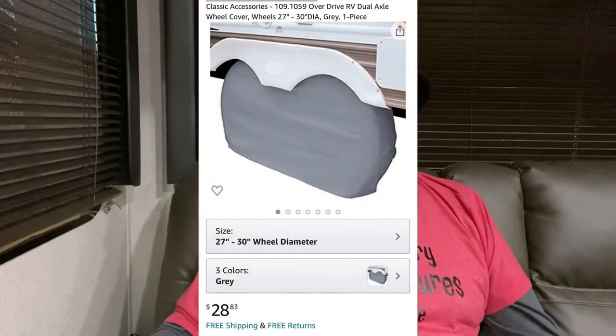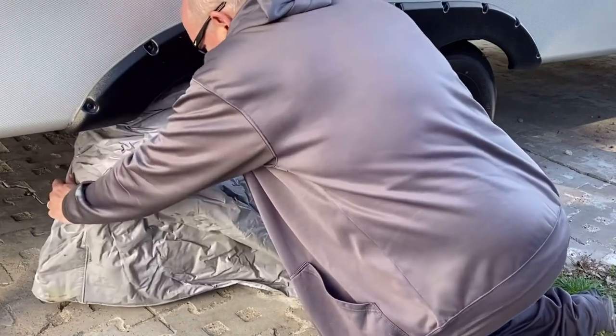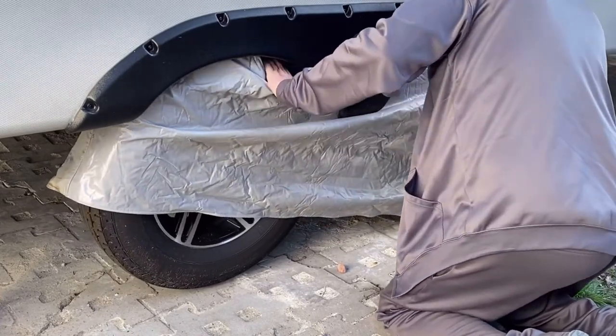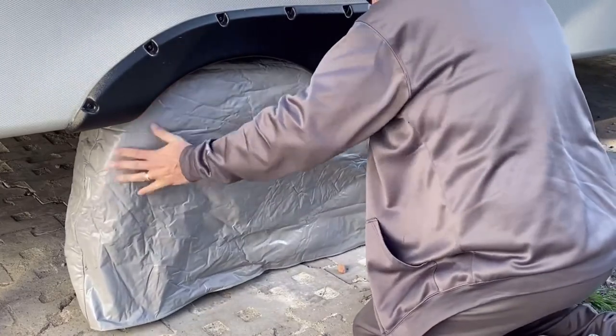The last thing I want to talk about for tire maintenance is winter storage — times when you may not use your camper for extended periods. One thing that is not a tire's friend, besides the speed you drive, is the sun. If you can purchase tire covers — and they don't cost very much at all — they come in single units or ones that cover each tire individually, or the ones I have that fit over a two-tire tandem axle situation. Any time my trailer is going to be sitting for more than a month, I cover my tires to keep the sun from beating on them, and hopefully that will aid in the longevity of tire use.